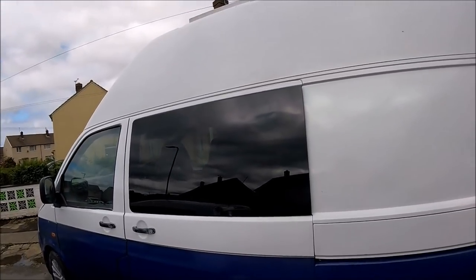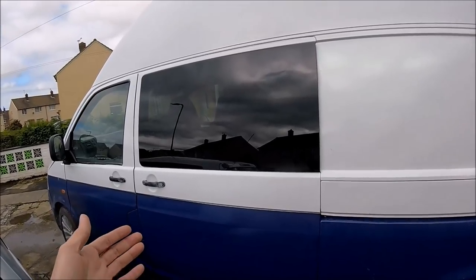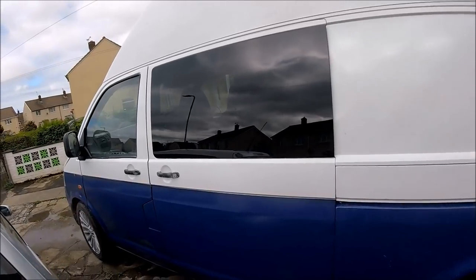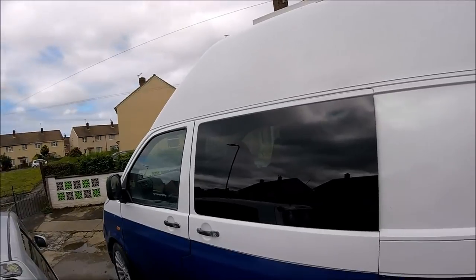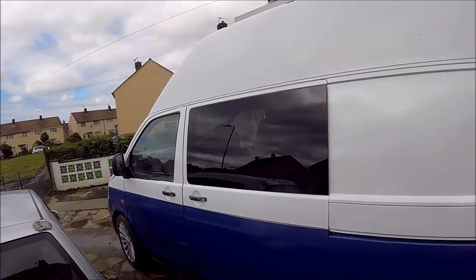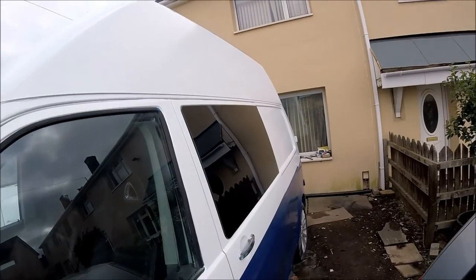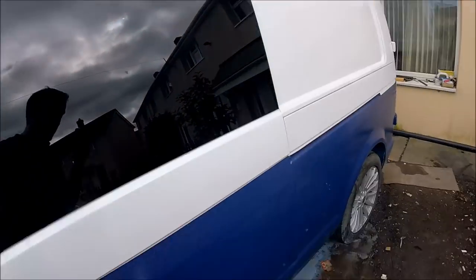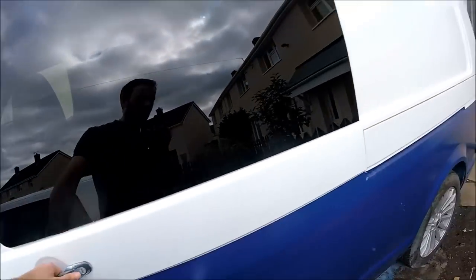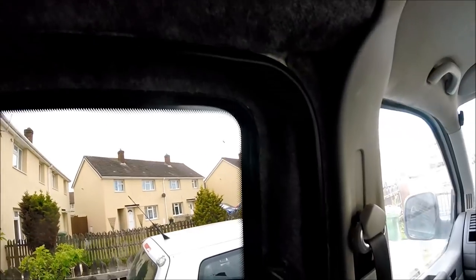I've left the bonding agent to cure up overnight and in the meantime I've fully re-carpeted the inside of the door as well. As you can see it's made a hell of a difference fitting this window compared to the little caravan window I previously had fitted - it certainly opens up the inside and gives a lot more light straight in. It's a nice neat fitting and finish, especially for the first time I've fitted a bonded window. We've also had a good downpour and there's been absolutely no leaks inside. If I shut it up you can see the rubber seal going all the way around, which gives a nice neat trim finish over all the cut metalwork.